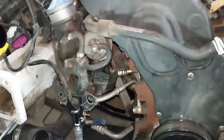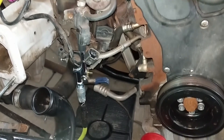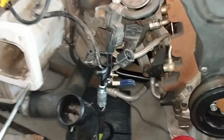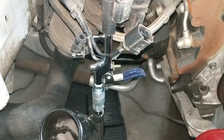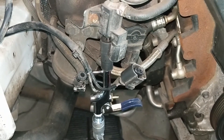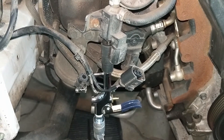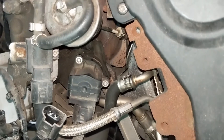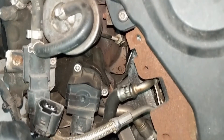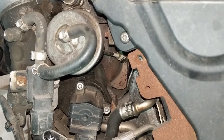If you want to diagnose if your wastegate actuator diaphragm is responding at the correct PSI, you can do another test like this. All I've done is taken off the bottom hose that is the input source of boost from the compressor and replaced it with my air gun at 20 PSI — above the OEM standard of around 10 or 12 PSI that the engine should put out on a stock tune. We introduce this pressure and see if the diaphragm moves and if the rod behind it moves as well. You can see the rod reacted and then slowly came back into the resting state.